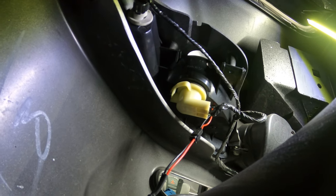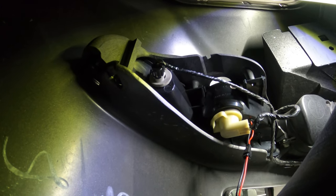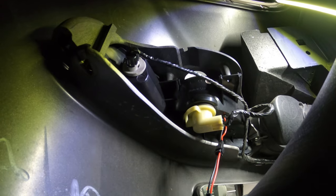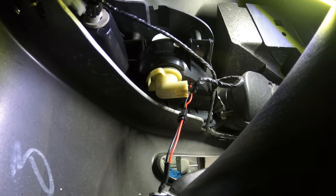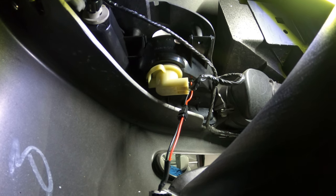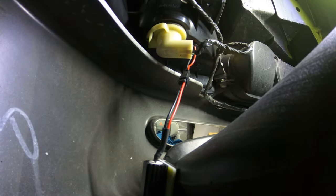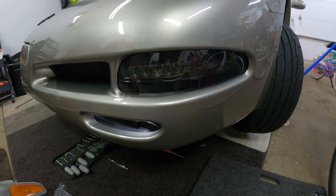We are in place. It just kind of rolls over — you basically put it all into that housing, and then it just falls into place. If you keep that one bolt in, it kind of just rotates in there. I recommend tightening this outer left one first, because that'll hold the housing down. Then you can tighten the light to the housing. Notice my one, two, three connections are done. On the left we have the gray one — that's the small connector. In the middle is the big connector — it's off-white from age. The black wire has to match the black wire on there, so if you plug it in wrong it won't work. And the resistor is there — I haven't taped it down with double-sided tape yet, but I'll do that shortly.